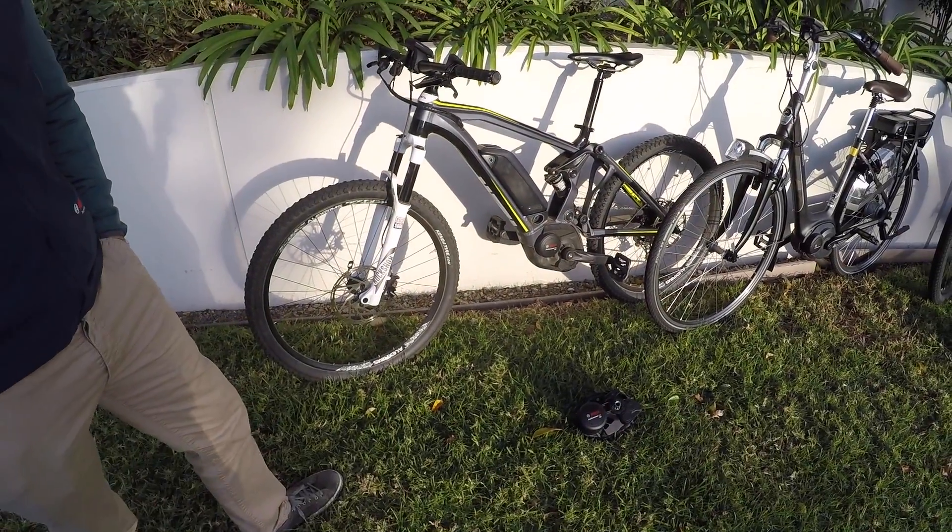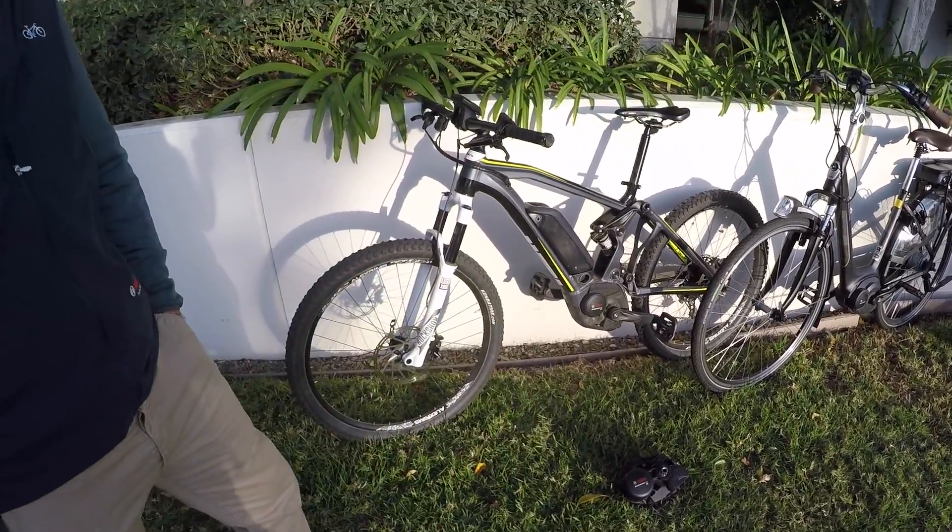That was the Performance Line CX. The other really neat thing about that specific drive unit is that it works with EMTB mode — Electric Mountain Bike mode. It's sort of a set-it-and-forget-it, all-in-one mode. The way the Bosch system normally works, there's Eco, Tour, Sport, or Turbo as the different assist levels. But with EMTB mode, you replace that with a full range — from 120 up to 300% support all in one — and it's more based on how you're pedaling and interacting, how much force you're putting into the pedals. That's the torque sensing.